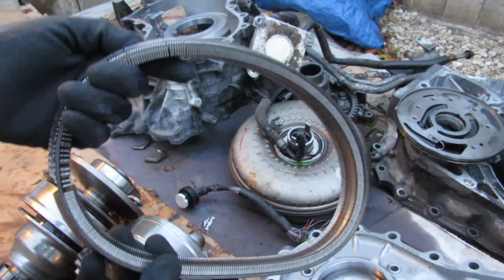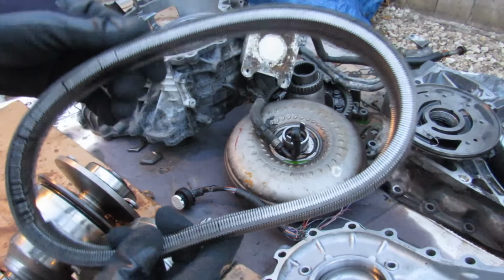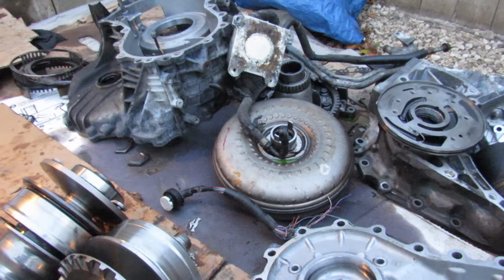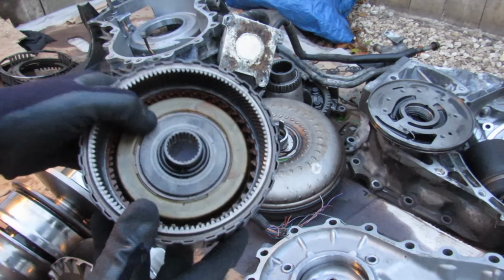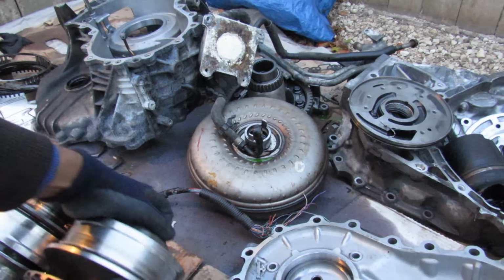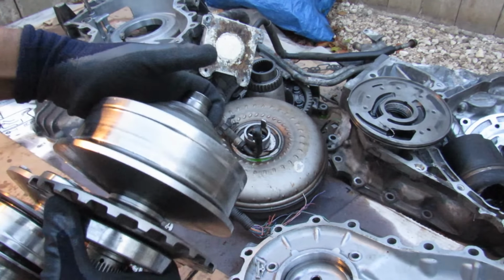Now of course that fuel economy does come at an expense, and that's because this belt does make a lot of noise, but not only does it make a lot of noise, it also kind of gives you a rubber band effect. You see, the thing is, with a clutch pack you can instantly lock and unlock this with just a change in pressure on your valve body, whereas this big drum over here, you've got to fill this drum up, and thus when you floor the gas pedal, it's going to take a while for this variator to change its ratio for you to accelerate fast.